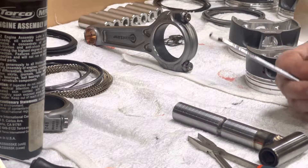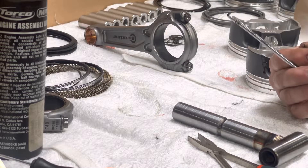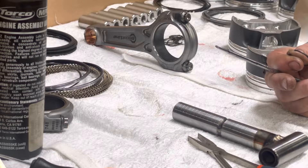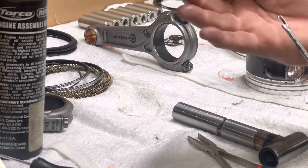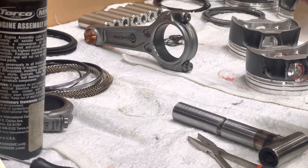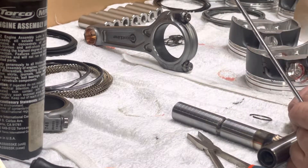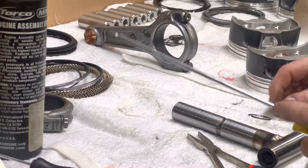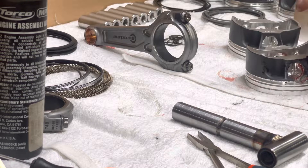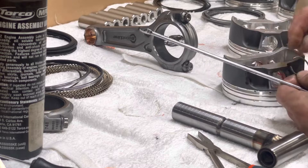This is a Ford headlight adjustment tool I bought from Snap-on back in probably 1990, and I've modded it a little bit. It's something you could make with a die grinder and a screwdriver. It's just got a little hook and a notch ground down in it. You could also use a tire plug tool — just grind it so you have a little forked end.